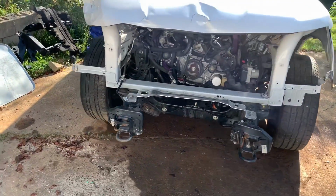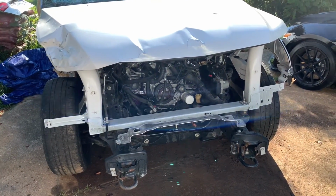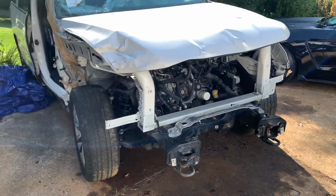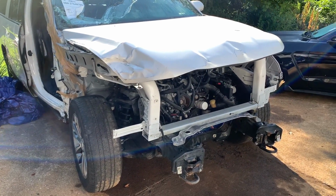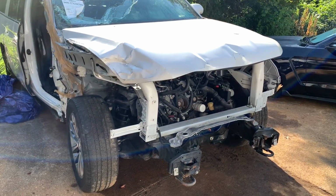Looks like pulling the engine in a driveway was a complete fail. It just does not want to fit through the front of the vehicle, so I'll have to take it to the shop and lift the whole cab with the lift and lift the whole engine, transmission, and transfer case out like that, which will be much easier. I should have just done that to begin with.